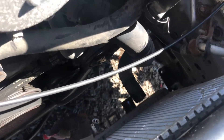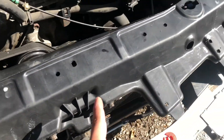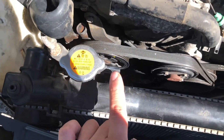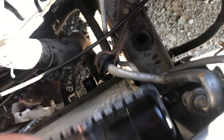To summarize removal: remove those hoses down there, remove the fan, take off the 10-millimeter bolts, remove the hoses up here, and remove that one right there so you can have access to move things further back.